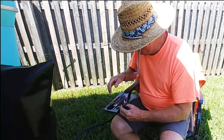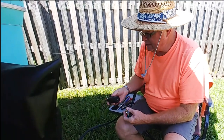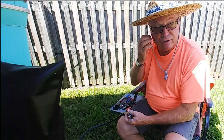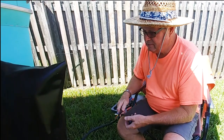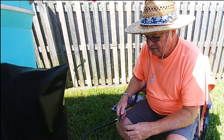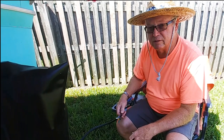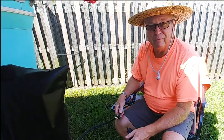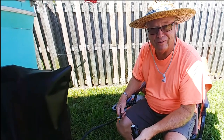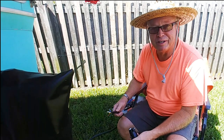What I would do is bend the prongs and it would work for a little bit, then stop again. I checked everything on the truck side — everything there is good. Checked the connections on that plug and everything was fine. I think this plug is the culprit, and if it's not, we'll continue on. When it's an intermittent thing with electrical stuff, you do the simplest, cheapest thing first.